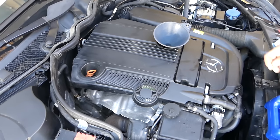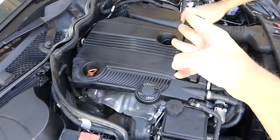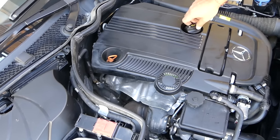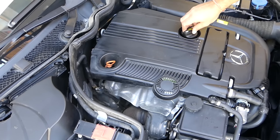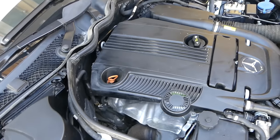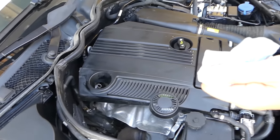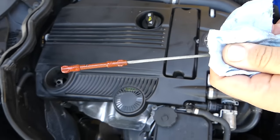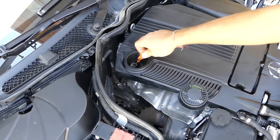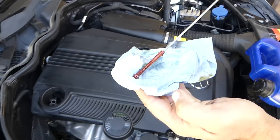Close the cap first. Check three things before starting the car: oil drain plug is tight, oil filter is tight, and oil cap is placed on. Also make sure you've put sufficient oil in. Pull the dipstick out and wipe it, then put it back in, pull it out and check the level again — it's just barely less than the full mark.